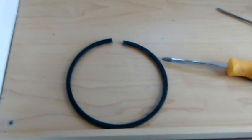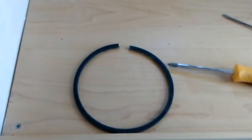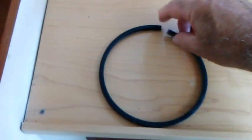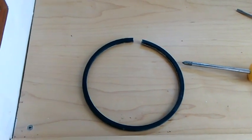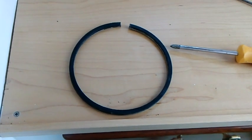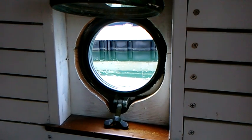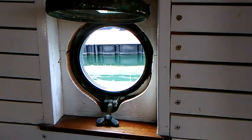The gasket came right out and you can see that it's clearly broken. So I'll put it back in but with that break up at the top. That should solve the immediate leak problem, and then what I'll do is put some silicone rubber in here just to close up the gap. That should basically fix this leaking gasket. I'm going to go up there and clean out the groove that the gasket goes in by wiping it down with a paper towel and maybe a little alcohol.